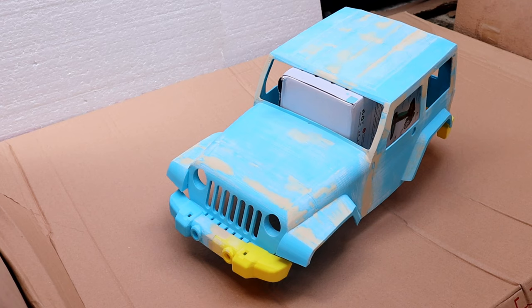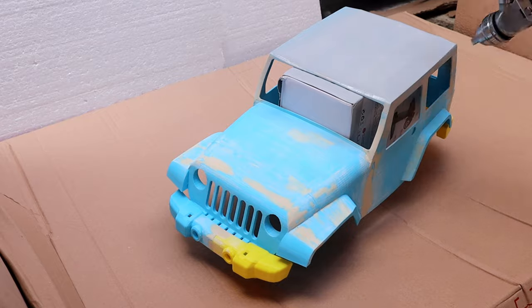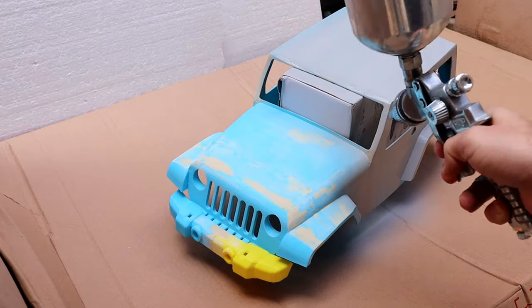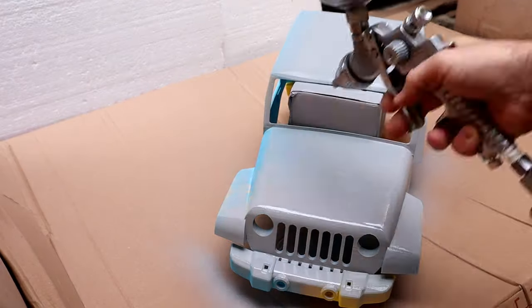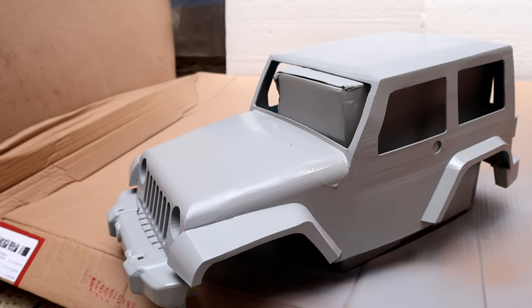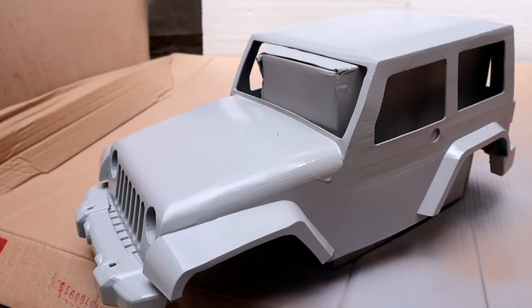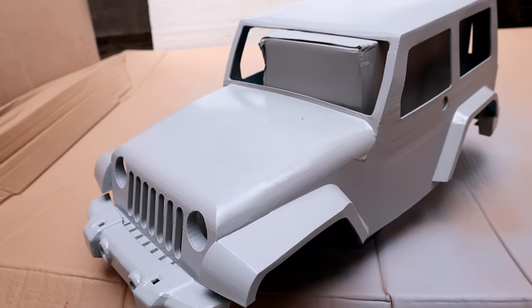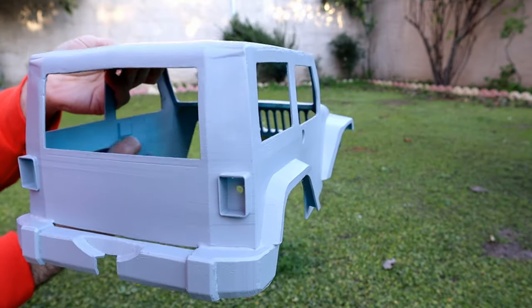I am finally done sanding the body filler. Now I will apply primer. One spot had a paint run, which I can sand down when it gets dry. I leave the primer to dry for 1 day.